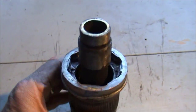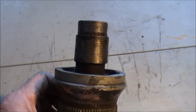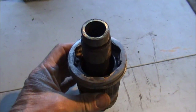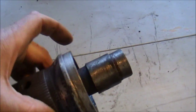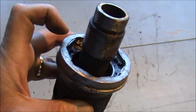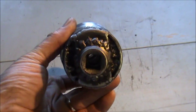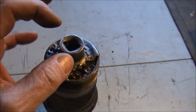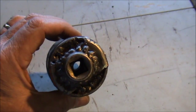This tube here is welded in the middle - that's actually a brake rod, or the remains of a brake rod, a brake bar off a 1926 Bullnose Morris Oxford that I just happen to have lying around the shed. The idea is that this actually slides inside the axle housing and then that octagonal socket grips on the nut. I got an old end off an old socket set and welded that on there so I could use a half inch drive socket on there.